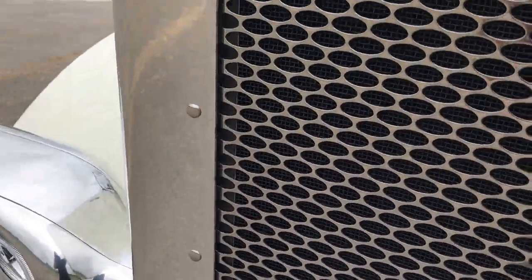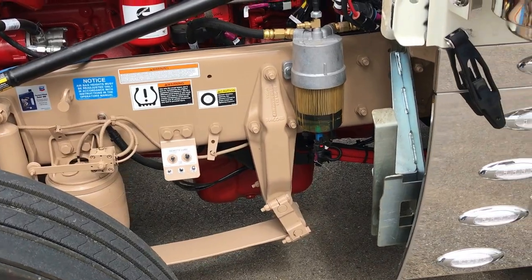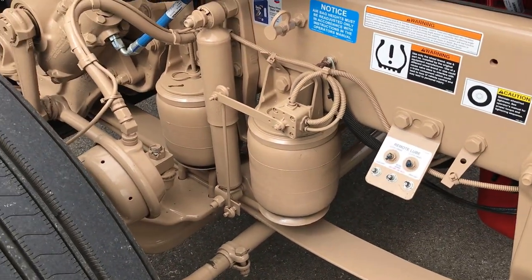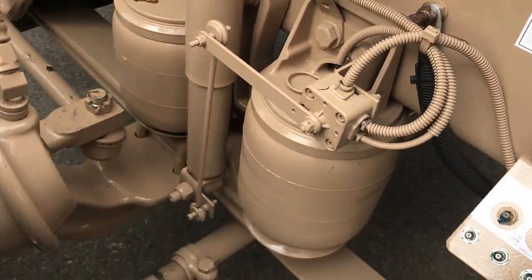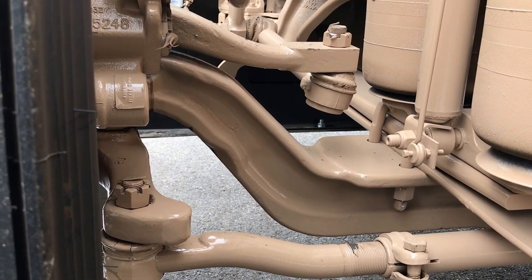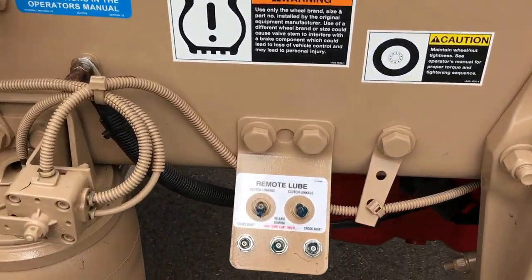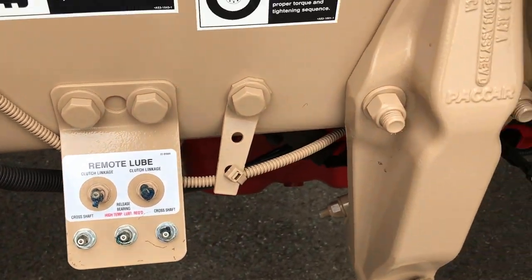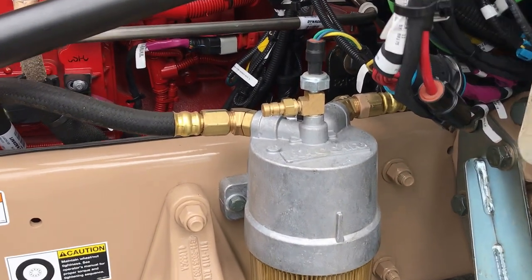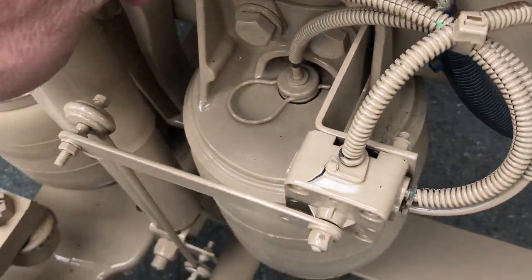Of course this truck has the three grill bars — we can do four more for a total of seven. The hood won't always sound like that; until they've been opened a handful of times they're a little squeaky, but they have been greased. Looking at that air ride front end — dual leveling valves, one on each side. That bend in the axle there is how you can tell whether it's a three and a half or a five inch drop, and this one's the five inch drop. Remote lube. Heated fuel filter. Two service ports for checking the fuel system — a nice little upgrade, much easier for mechanics if they ever have to test the system.